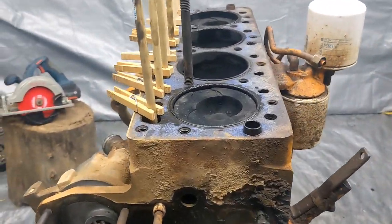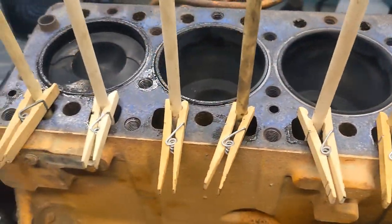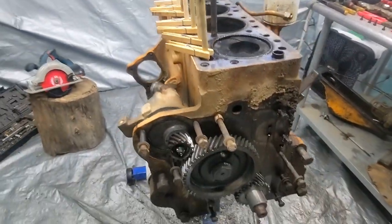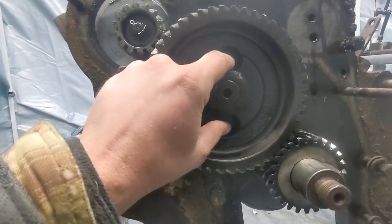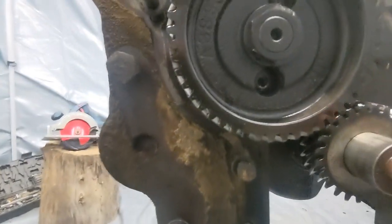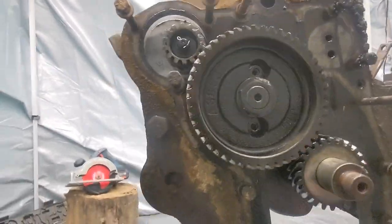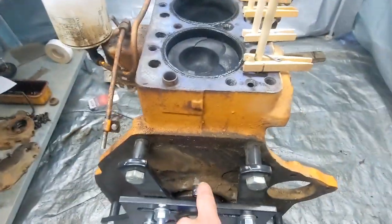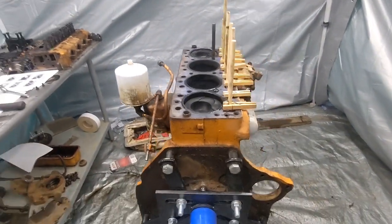Alright, so I've got the engine flipped back over. Per the manual, you take a 3/8 dowel rod, push it down on the lifters along the camshaft, pull the lifter up off the camshaft, and secure it with a clothespin. This is the camshaft itself - the end of it - this gear here. You line these two holes up so you can get the bolts out. I've already got them out - just these little bitty guys. So now I should be able to just pull the entire camshaft out, and we'll have that out. Then I think it's going to work to get these out, so then we can get that back housing cover off, and we can pull the camshaft out, knock the sleeves out, and this engine will be completely torn down at that point.